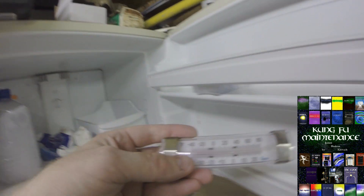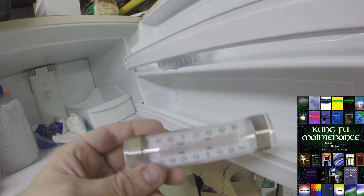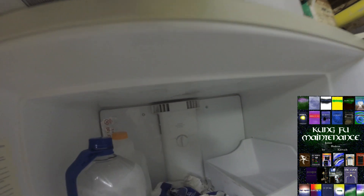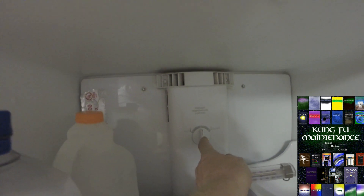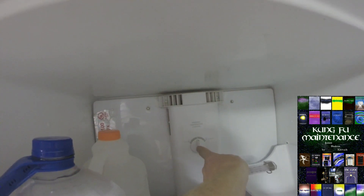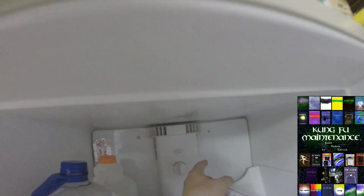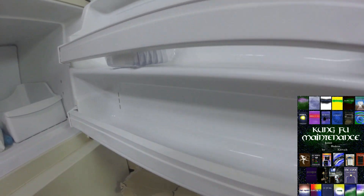I figured I'd also show you this — it takes a while to adjust, so you'll really have to close it in the freezer and leave it for a while. But I thought it would give a good opportunity to go over your ideal settings for your freezer. You really want to leave your freezer at factory settings, which is the center here. You don't really want to adjust it to the coldest setting — from experience, a lot of times you'll get too much ice freezing up and then blockage and all sorts of stuff.